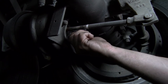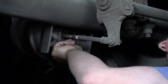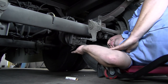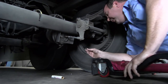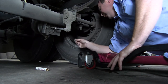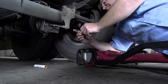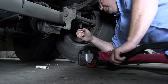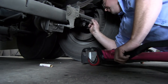This trailer is illegal to run — you cannot drive this trailer. Remember: two inches is manufacturer spec, two and a half inches is the DOT limit, and this brake is definitely out of adjustment. Now that we know this brake is out of adjustment and this trailer is already out of service, since we're already down here with the brakes applied, we can also check the thickness of the brake. Because if you've got one violation, it doesn't mean you don't have multiple. Moving into the thickness: on the pre-trip tool, this end piece represents the quarter-inch mark. If the brake lining is below that step, the brake is too low and will need to be replaced.